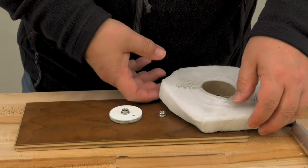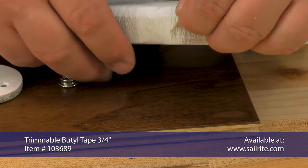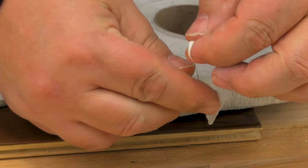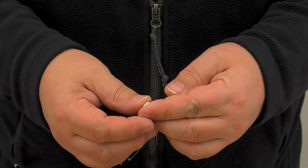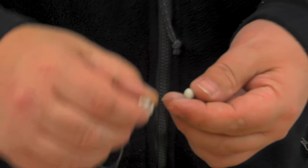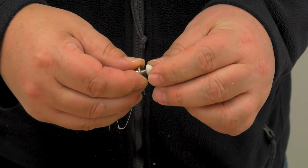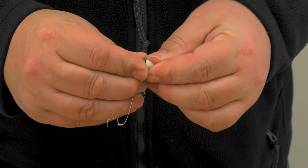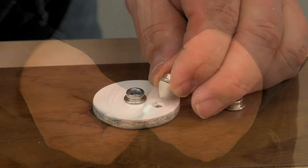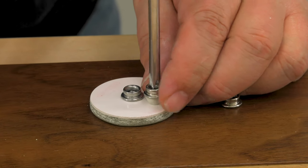For the best bedding compound, use butyl tape. Butyl tape always stays tacky and increases in adhesion with age after it is applied. It forms a water and airtight seal. Removing a piece of butyl tape, we will roll it into a ball in our fingers, then form it around the threaded post of the screw. The use of butyl tape is only necessary for a watertight seal — for instance, when you are installing these snaps in a fiberglass boat.